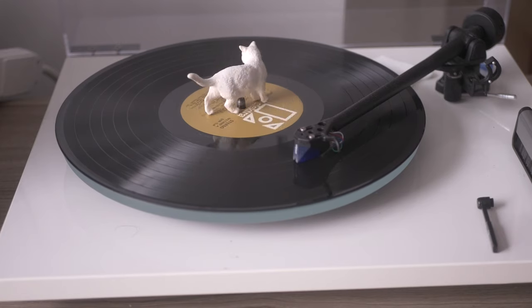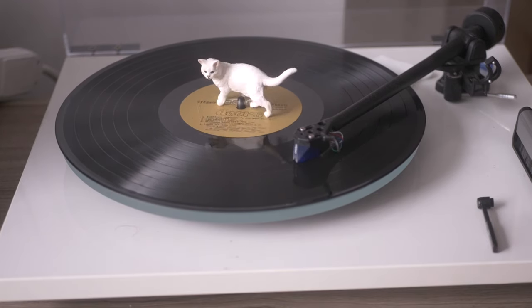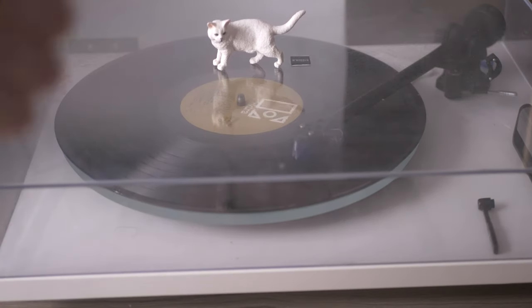And that is exactly what you should be doing if your record player comes with a dust cover. The dust cover creates a chamber where reflections and sounds from your speakers can get trapped and amplified, and your needle picks up those sounds, giving you more distortion — especially at higher volumes. Just lift your dust cover up and you'll get better sounding records. The only exception: if you have a cat that likes to climb on your records, keep the dust cover down.